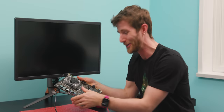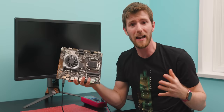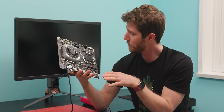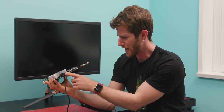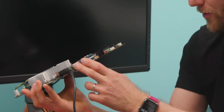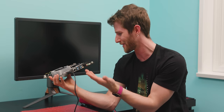Let's talk about what else is unusual about this motherboard. The form factor is something I have never seen before — approximately the size of a micro ATX motherboard but without the same mounting holes and no PCI Express expansion slots. The IO is all over the place. On the back we've got HDMI, Gigabit Ethernet, USB 3, SATA, and audio. Why does SATA need to be on what is apparently the rear panel of whatever device this is intended to be installed in?